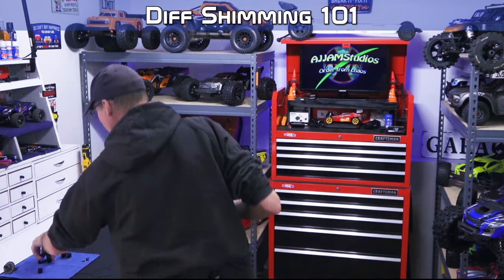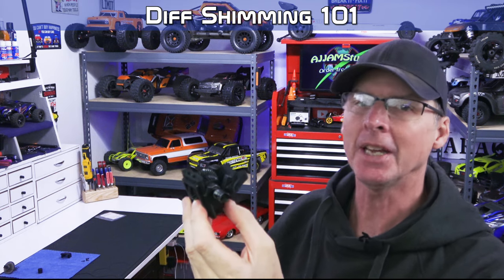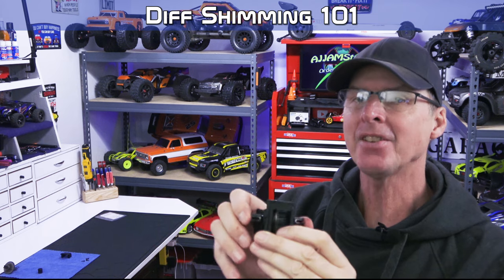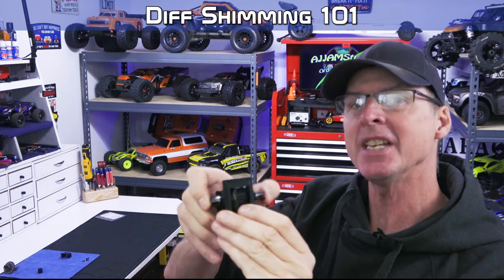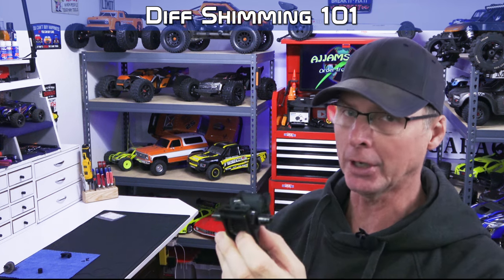But if everything's going good and you've run it for a while, pop the cover and have a look if that spacing changes. And what I mean by that is, when this sits in the housing, it'll pop in like so, and now it's in there. That doesn't mean it'll stay there. You might have a little gap in the casing here. The race might not be sitting in exactly the right spot, but it sits down and it looks good and it's going to work. But as it vibrates and as it throws torque back and forth, these pieces will settle into place. Once they settle into place, which is a battery or two, pull the cover and see if it changed. If it changed, that's when you throw your extra shim in.